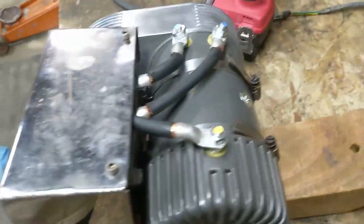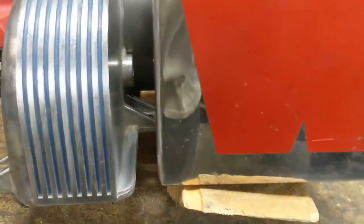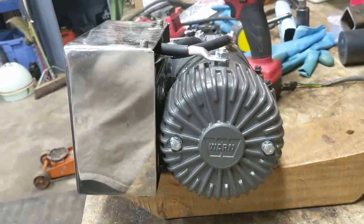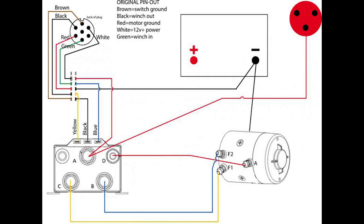She is basically all back together. We've got good clearance with everything. This thing was super tight before — I was having a problem with it catching that ear right there. After we flopped that case around, we've got quite a bit of room. Now that the mock-up is all finished, we can talk about the wiring diagrams. First picture shown is for a three-wire remote, and the next picture is for your five-wire later remote. Also, the 68608 motor comes with a motor spacer — you do need to use that when it gets installed.